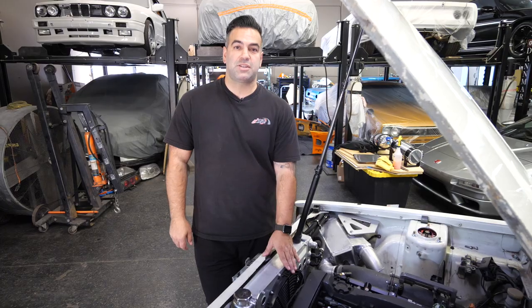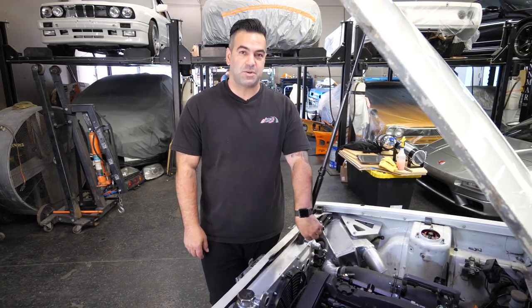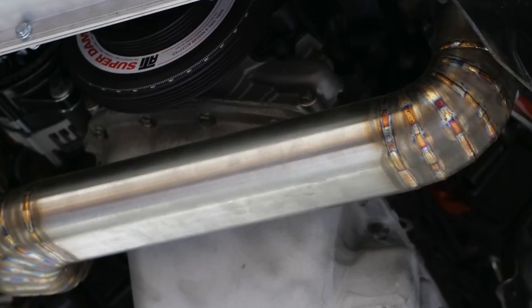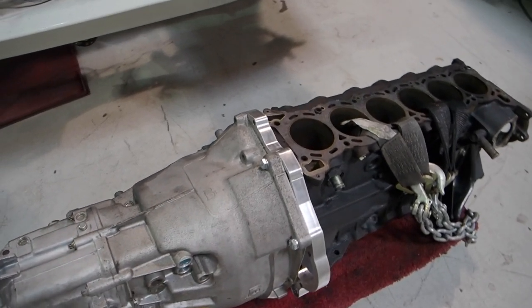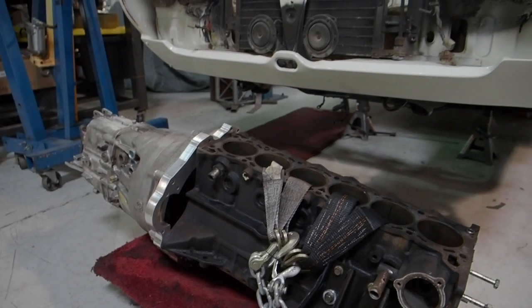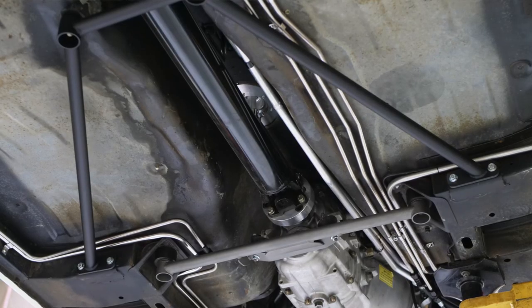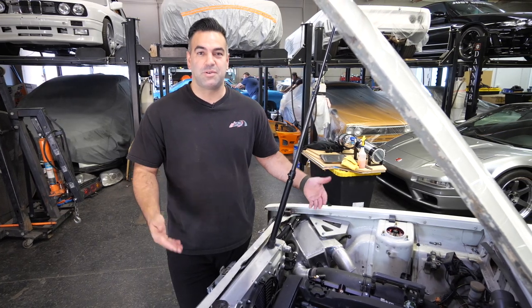Because we did the air-to-water intercooler setup, we had to get the hot side to meet the cold side. Richard pie-cut oval tubing that crosses underneath — it is not the lowest point; the oil pan is still the lowest point. The ZF BMW transmission is attached to the drivetrain with the detent pins done, the springs done, and all the failure points addressed. It's got a Clutch Masters clutch in there. We're going to have a custom under-tray to protect that oval pipe, the oil pan, and all the items underneath that could potentially see road debris.